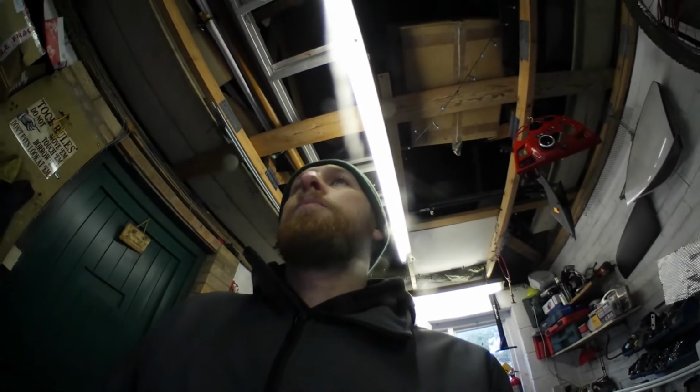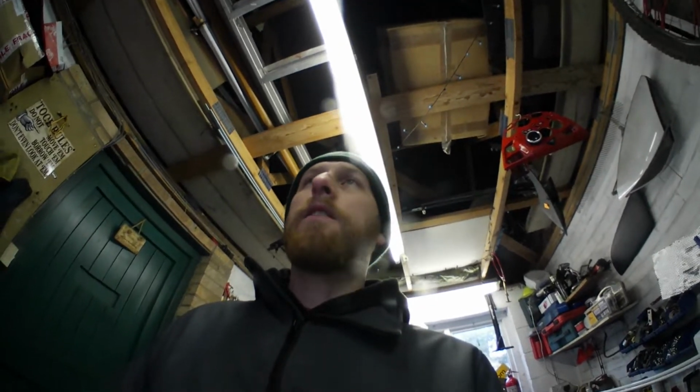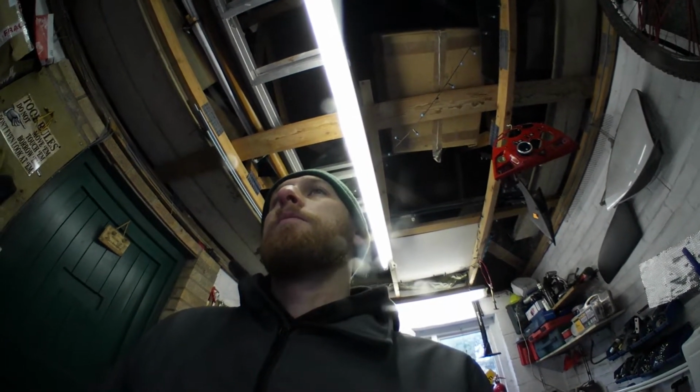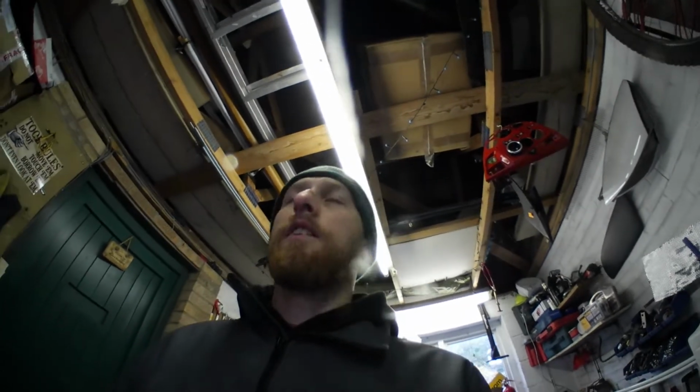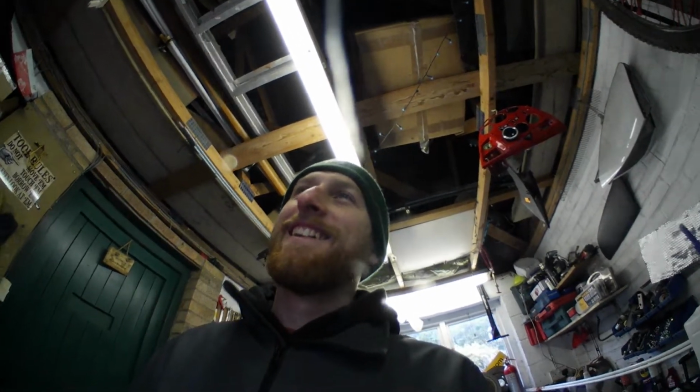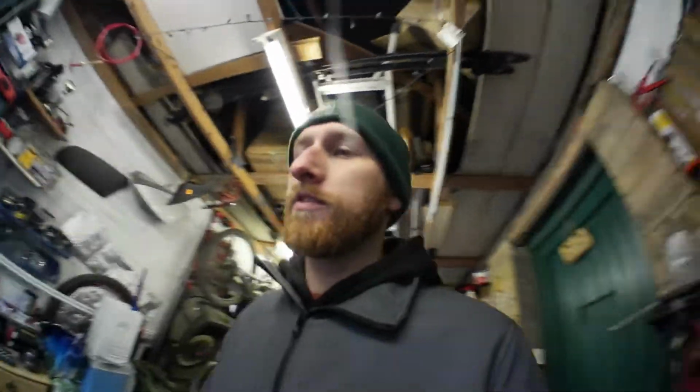But the pedal just felt long, as it would, because you're near the end of your life with the pad. So I put the new pads in, took it for a drive just to bed the pads in, and the brakes feel really mint again. I don't know how that's going to translate in the next track day. Probably going to be locking up everywhere, but I thought I'd show you them because I thought it was quite funny when I took them out and they were all cracked.